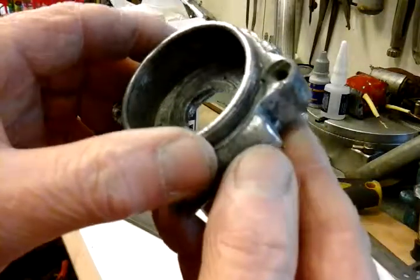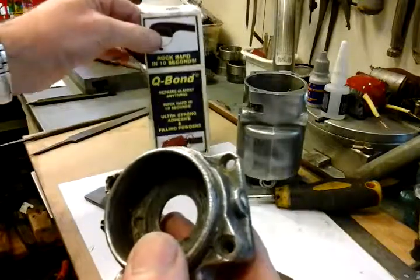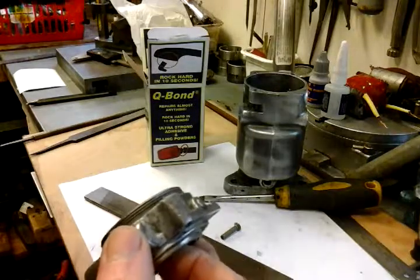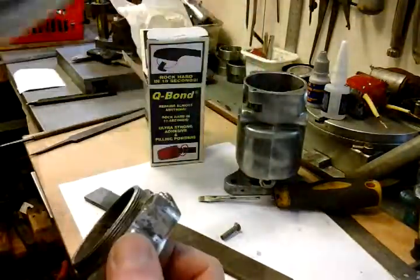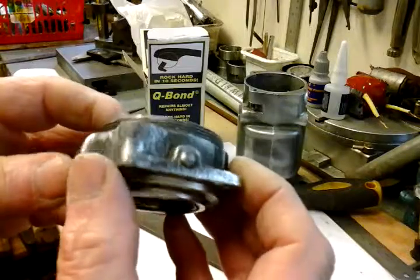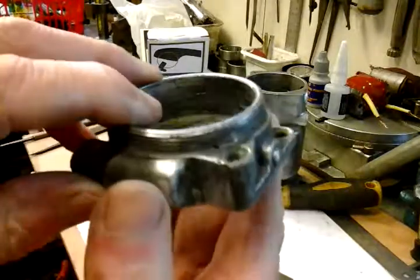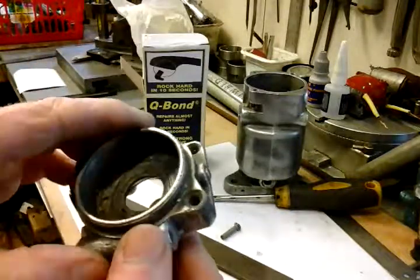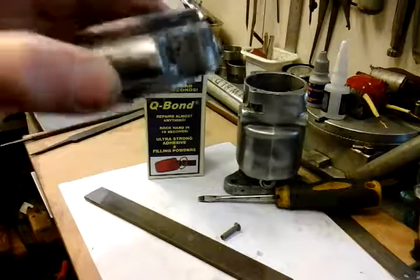I'm happy with that. I just thought I'd share that with you, because it's the first time I've used Q-Bond. I explained in my last video, I was thinking of having it TIG-welded, and I was thinking of having it Lumi-Welded with my Lumi-Weld kit. But with Lumi-Weld, you've got to get the casting right up to not far off the melting point of aluminium for that to work, and I didn't want to have to do that. So that Q-Bond has done a nice job — the first time I've used it. For a quick repair, that's a bit of good kit if you haven't got any. Okay, thanks for watching. Catch you on my next video on my progression with the Magneto build-up.